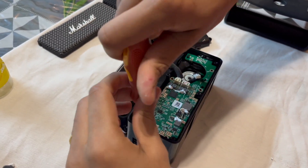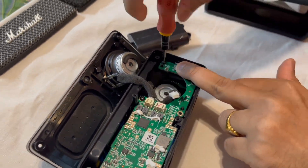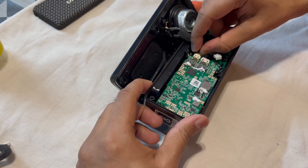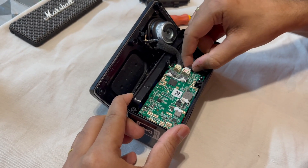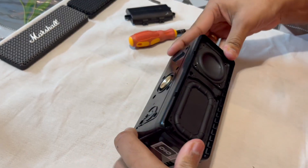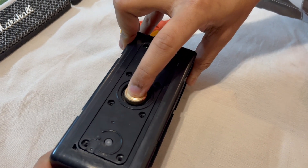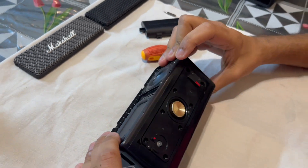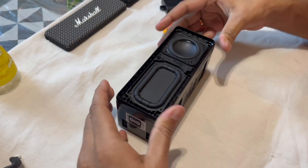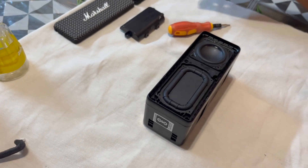The connector for the front speaker is already connected — it's the same clip type, you just push it in. Similarly for the rear, I'm just going to push this in as well. Before we screw all of this back, we're just going to power it on by long pressing and checking if it powers up, so that we know it works. As you can see, we get a 4-indicator light. This shows that all the components are fixed properly and the power is properly connected. Next, we'll close this up with the set of screws.